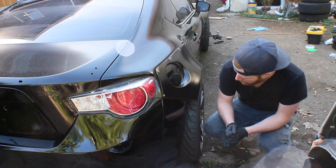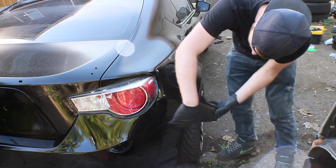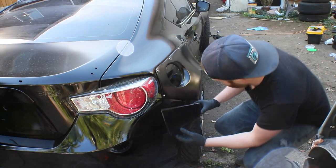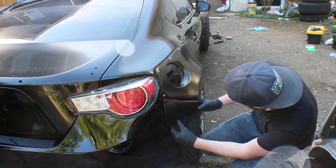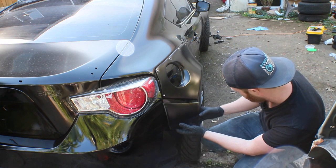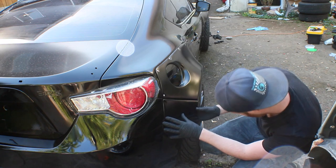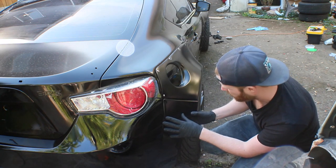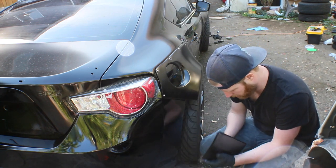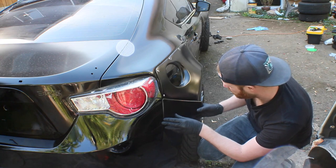Now that we've got the front done, we're moving over to the back. I'm going to do the same process — mock up my pieces, find out where my safe zones are for cutting, and then tape something off. I think I'm going to cut about two inches off into this bumper right here, make sure I have room for my wheel, and then this piece will lay on here just like this. Since the bumper is all mounted up and I'm not having to rebuild it from scratch, it's going to be a lot easier application. I'm going to tape off the safe zone, cut it with the body saw, drill my holes and mount.